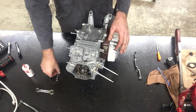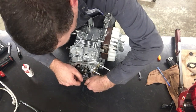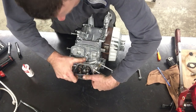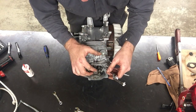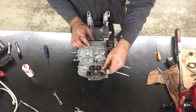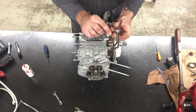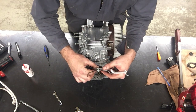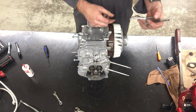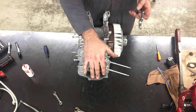I've done a few of these before with students rebuilding engines every single year. It's actually good news when it starts a little tight, because loosening it is the easiest thing to do. This feels really good. To confirm, I'm going to try to slide the seven thousandths gauge in — I still can't get it in without forcing the valve open. The six thousandths goes in nicely, so I actually have exactly six thousandths of an inch.